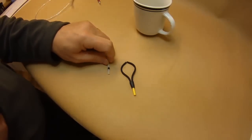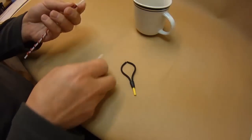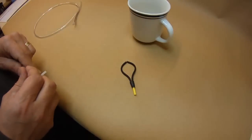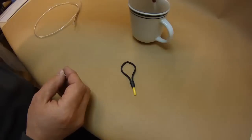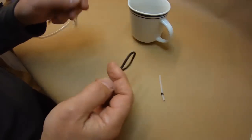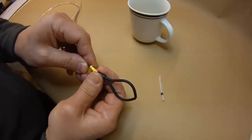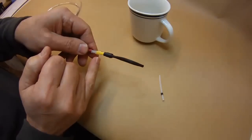Quick top tip about fitting the nozzles into the tube and the helix. Because the helix is a semi-rigid plastic and it's a fairly soft plastic, sometimes in low temperatures this area can get quite stiff. A little bit of hot water from the kettle — just leave it in for a few seconds — and it'll fit very easily. Make sure you get right in up to the little black line on the single feed. On the twin feed it's slightly more difficult because it's a larger bore, but as long as it's been softened in hot water it should be fine. Firmly push it in right up to the end for a good firm grip on the twin feed nozzle.